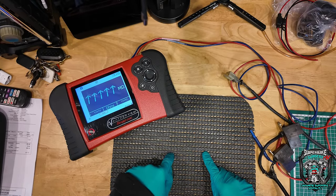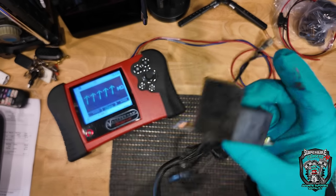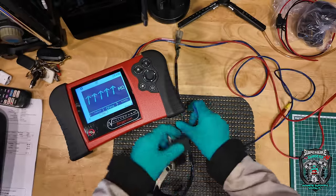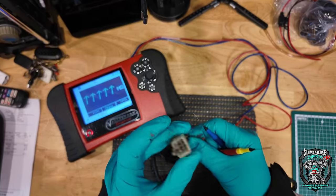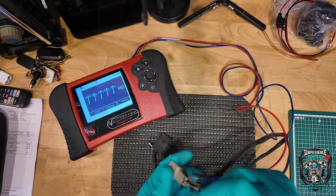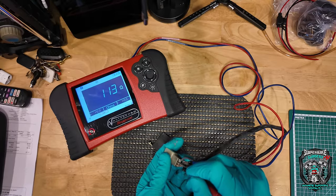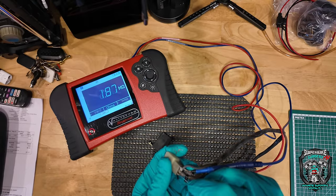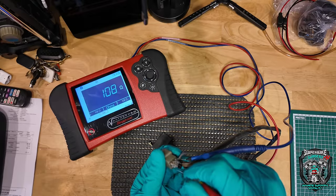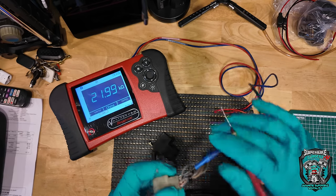So basically rear cylinders and front cylinders. The spec is 110 ohms plus or minus 10 percent. The first one — let my meter catch up — that's 113 ohms, fine. Next one: 112. Next: 108. And the final one also checks out. Certainly statically they test okay.